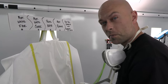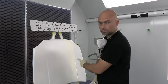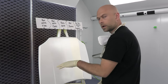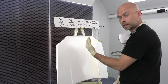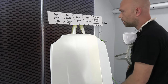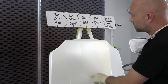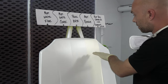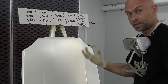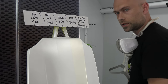That's three coats — we're going to do one more. We're back in the booth, it's been about an hour since our last coat went down, everything's nice and dry. We're going to put some 2K automotive clear over the top so you guys can see what it looks like. The difference is really subtle in the booth lighting, but that's kind of the beauty of what we're going after — showing how you can create texture with different metallics. A quick recap: metallic white fine, metallic white coarse, pearl white, metallic platinum, and hot rod sparkle white over AutoBorne sealer white.